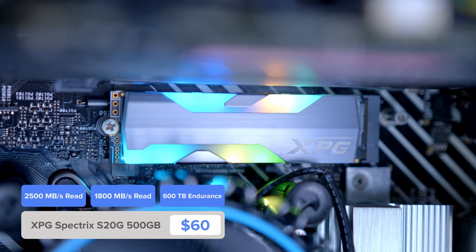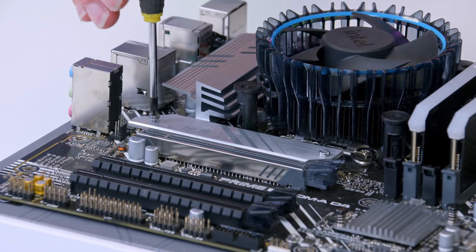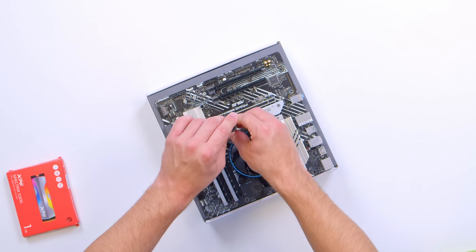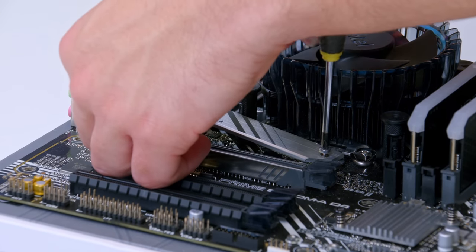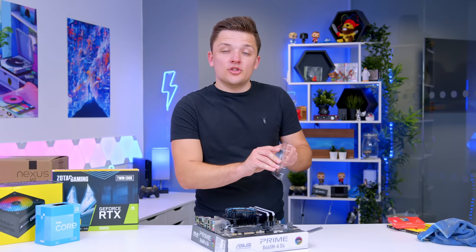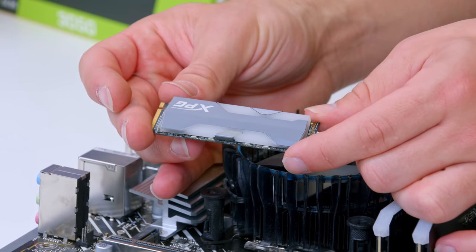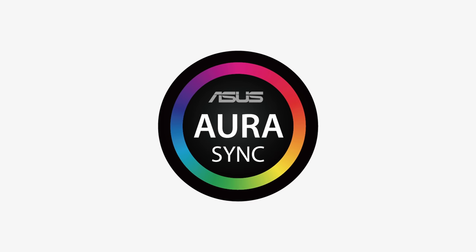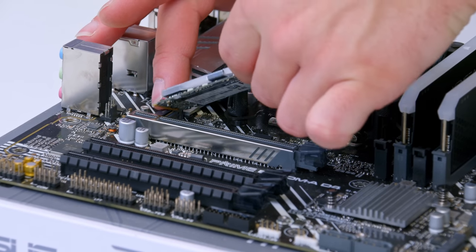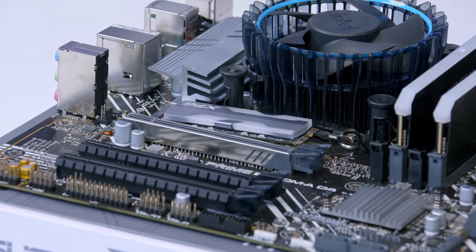To install the SSD, we need to take a look at the M.2 PCIe Gen4 slot. It supports the latest standard of drives, but we've gone for something that's still going to deliver more than 2GB per second as far as read/write speeds are concerned, but doesn't break the bank. Speedy Windows boot-up times with a wallet that hasn't been annihilated is always a win-win. We won't actually be returning the M.2 heat shield into place, as our drive has got its own — with a nice bit of RGB diffusion and a brushed aluminium heatsink that looks gorgeous. You can control the RGB through Asus Aura Sync. Slide your drive in at a 45 degree angle, push it down, and screw it in with the screw we just removed from the motherboard.